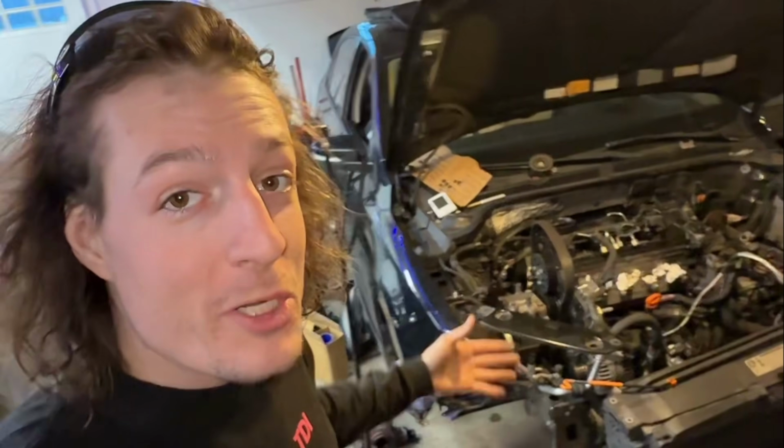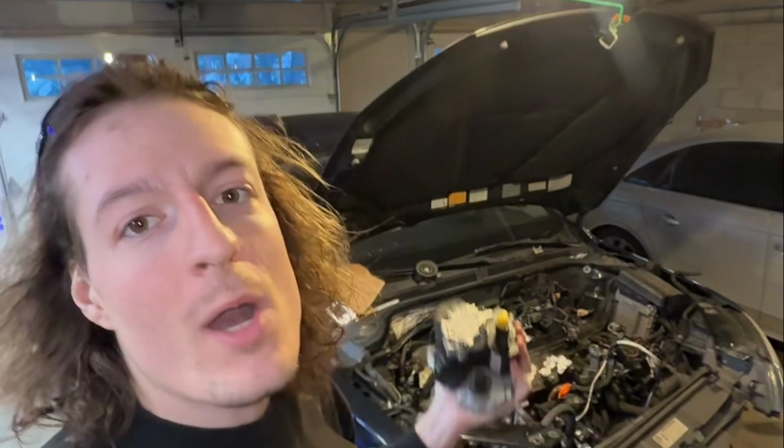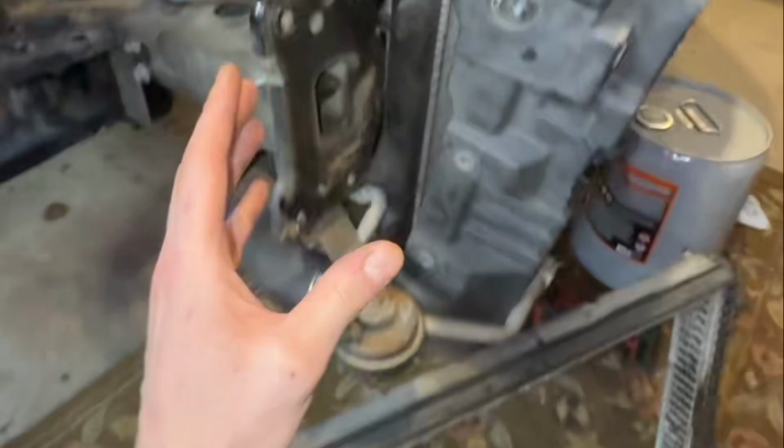Short answer, my turbo exploded and sent shrapnel into the intercooler, so I needed to get another one. Since I blew my turbo up, I ordered a bigger turbo, and since I needed a new intercooler, I ordered a big front mount intercooler, and I'm adding layers to the cooling system. But since everything in the cooling system is sandwiched around the stock intercooler and needs all these mounting tabs to center everything out, I'm gonna keep it there.